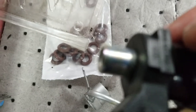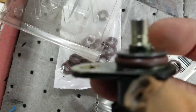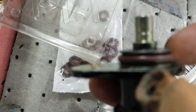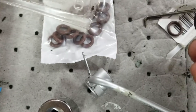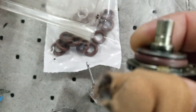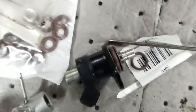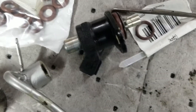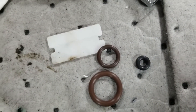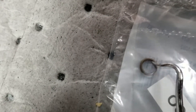And that's the injector here. The next o-ring you're going to change is on this portion of the injector, so there'll be a new o-ring in the housing to seal the top of the injector and another o-ring to seal the nozzle against the intake. The Fiero Store kit includes one for the housing and one for the nozzle. There is also a third o-ring, this tiny one, which comes in a separate package.